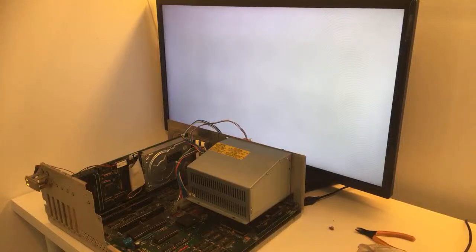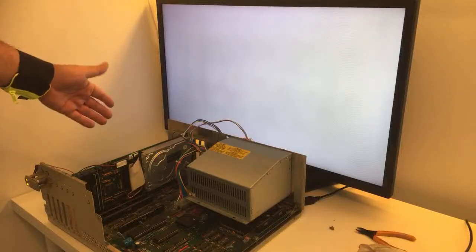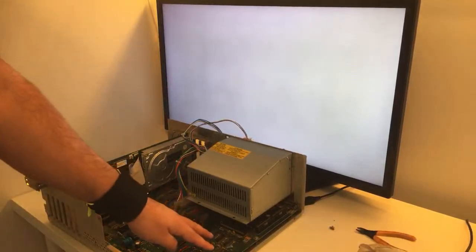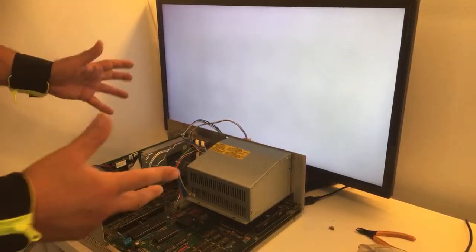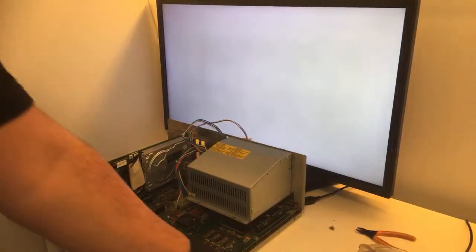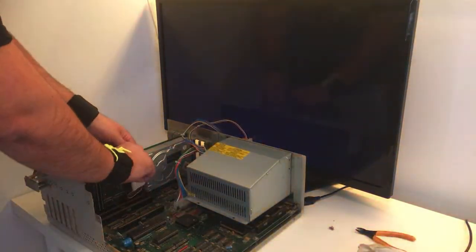All right, so I can try with a GoTek drive because I want to check the sound, of course. The thing I want to do actually is just unplug the hard disk. Just unplug it and see if it will boot with this card installed. Because, okay, dead hard disk, it is 35 years old, fully respect for that. But it could still be super nice to have 1 megabyte chip RAM and use these 2 megabyte fast RAM. I mean, it's easy to get some more RAM here, another hard disk, or a SCSI to IDE connector, or SCSI to SD. We have some different options.